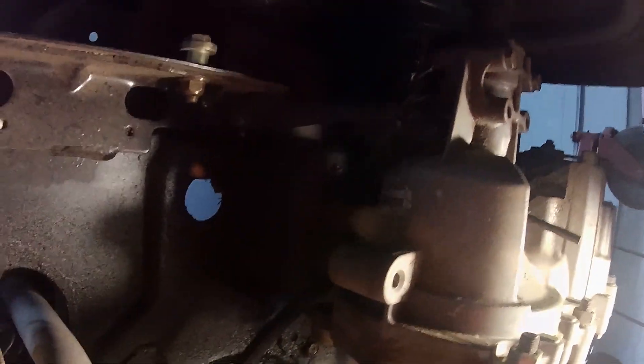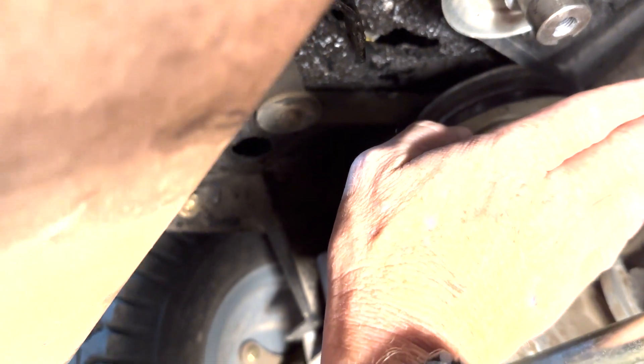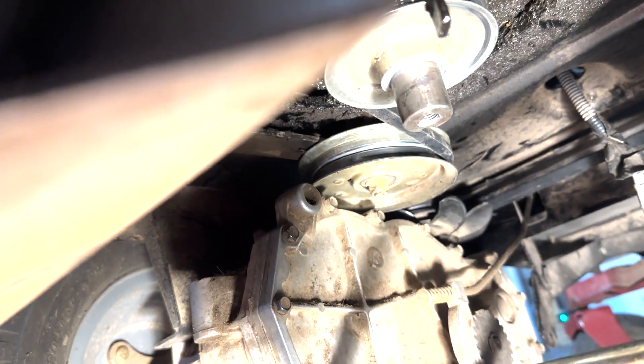Now I'm trying to get to the drive belt — this is the drive belt up here for the transmission, and this one is damaged. It goes around the fans so it's a little bit tricky to get out, but there we go. This is the back pulley and you can see I've got the new belt around it. This is the tensioner pulley, so I had to compress the tensioner pulley toward the left side, then take a screwdriver to work my way in, and it popped right onto the tensioner pulley.